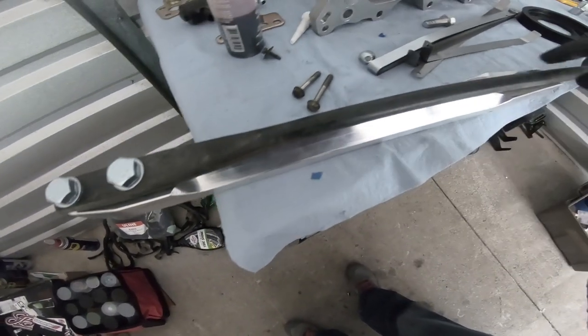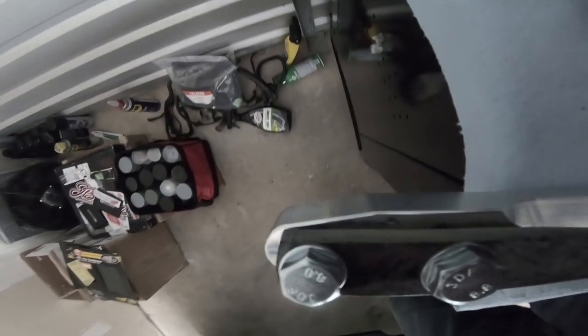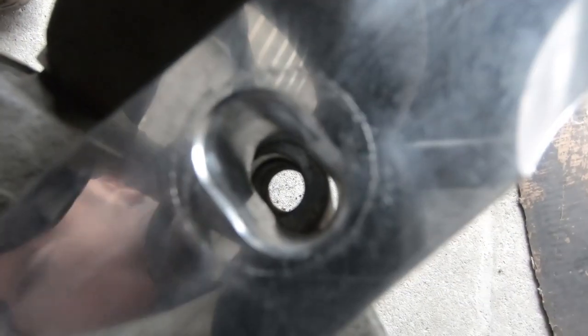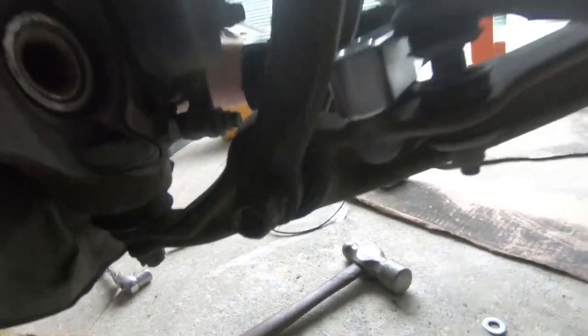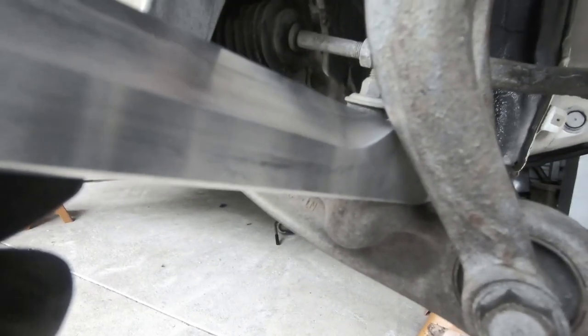Here's the Innovative bar on the bottom and the original bar on the top with hardware from the Innovative bar through the top. It's a little bit different of a shape, and because it's so much thicker, it ends up hitting — at least in my case — all around up here. It looks like I'm going to have to end up grinding around this bar to get it to actually fit. You should be able to see the hole is off here, just by a tad. Here's your back hole — still off. It's hitting right there and on the front. There's no way it would fit.